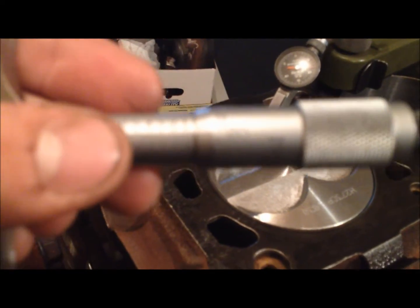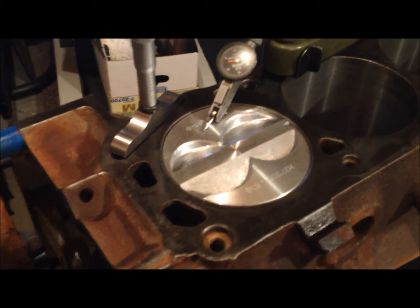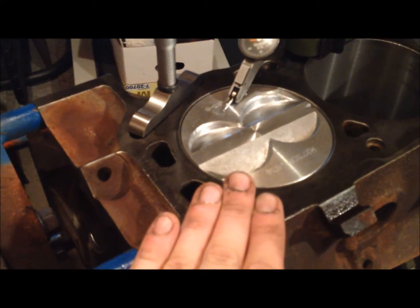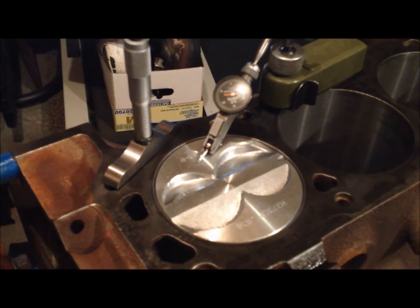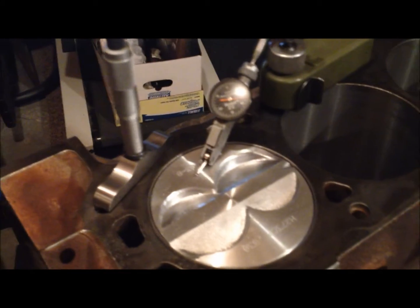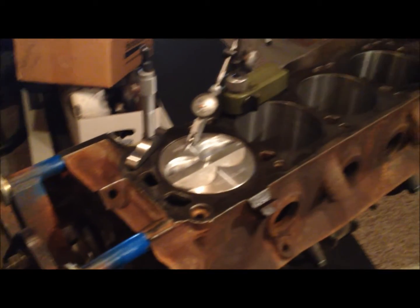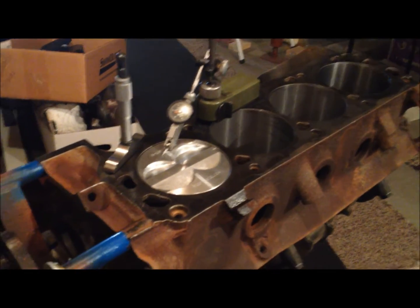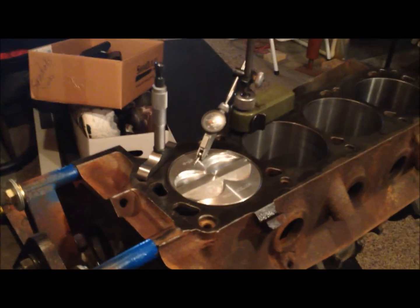What I found — you can kind of see the 20 — is that my pistons are 20 thousandths in the hole. So we need to take at least 20 thousandths off the top of the deck. We'll check this on all four corners and take it down to the smallest amount. From there you use proper head gasket thicknesses — I use Fel-Pro gaskets, which have designated compressed thicknesses — to figure out your final quench. After that, send your block back to the machine shop, get the deck planed, balance your rotating assembly, and move right along.